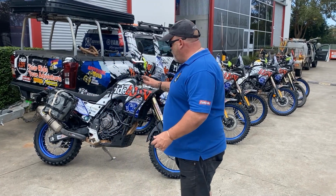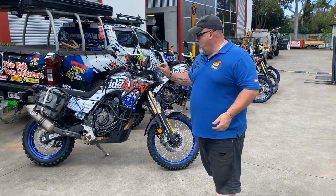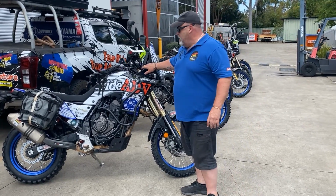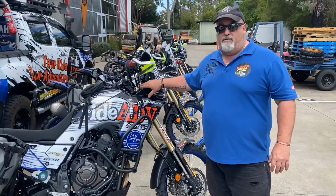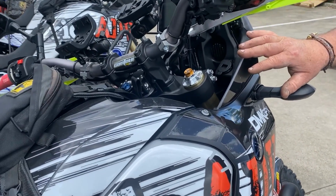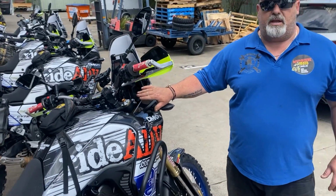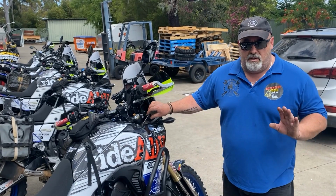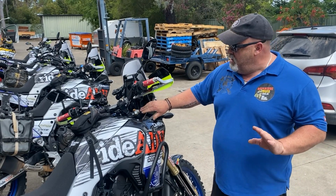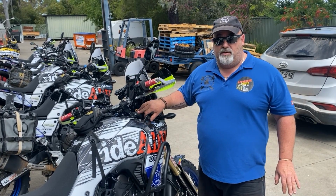So my bike here has a revalved standard shock absorber, revalved, resprung. Technic's IP is in the shim pack and the way they've done that, and I'm not going to talk about that. But of interest, at the moment, I'm testing a set of Andreani off-road rally fork cartridge inserts. Now these are $1,000. So they're not a $3,000 Öhlins kit. They're not a $2,500 rally raid. They're a $1,000 kit. They're really good straight out of the box. They're probably one spring set undersprung for me at the moment, and we'll get back to that later, but they are unreal. It's one rebound, one compression leg. I love them. Really, really good.